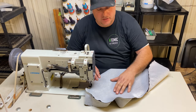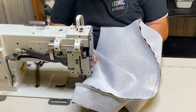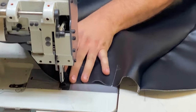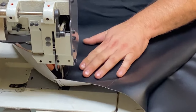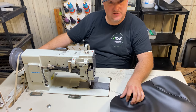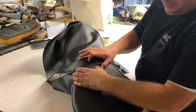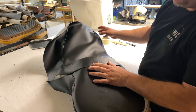What I'm doing right now is I'm sewing the front rider cushion onto the rear band that goes to the back seat. Now we're going to do the same thing — fold this over, do a single top stitch all the way around this. We start off, hit the machine in reverse to lock off the thread, and then we're off. Top stitch is on and we're going to test fit it again. We just set the seat cover on here, just trying to see if everything's going to line up good. Everything looks good. We'll line this all up and stitch this together — a butt seam and a top stitch.